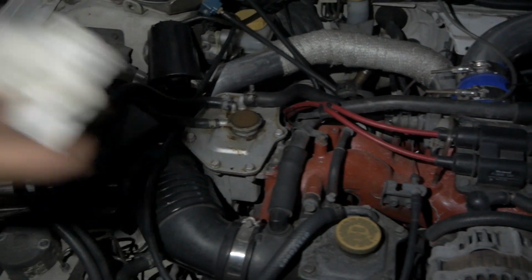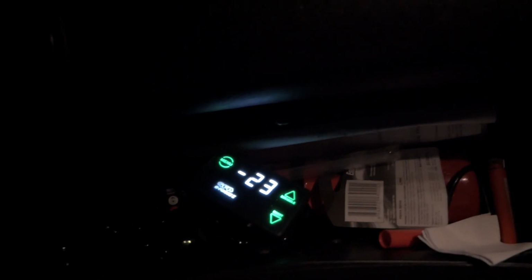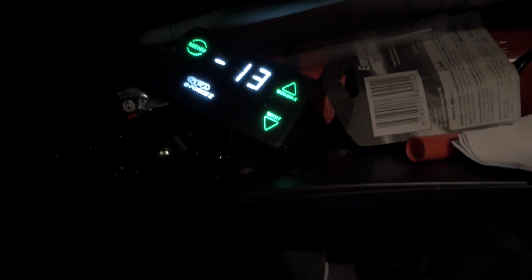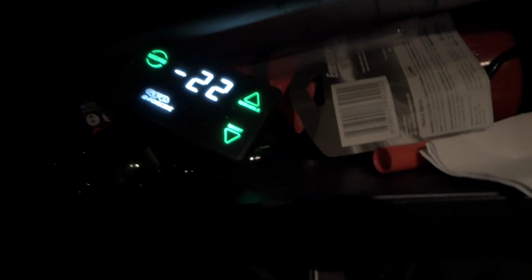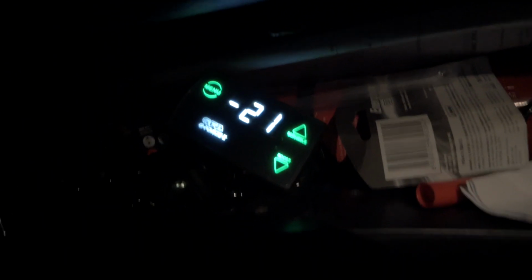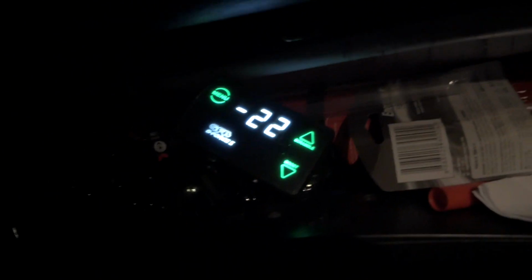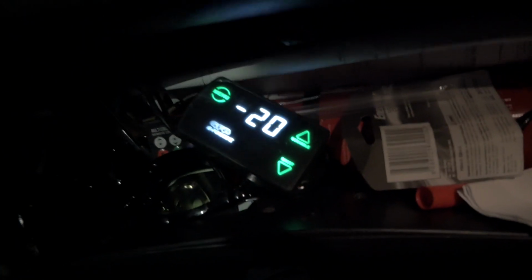But yeah, that soaked it up. That's what it looks like. So it's finally running 15 PSI, I think. Let's test that. Close to 12, eh? Okay, 12 is pretty good. We just need to readjust the duty cycle and stuff. But my solenoid started working again because I plugged it in properly. So we're sweet. It works now. And yeah, that's pretty much done. The car's going.